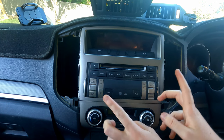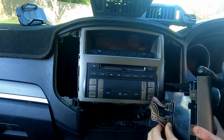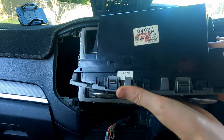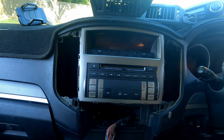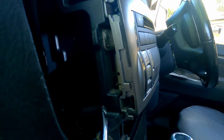Then you're going to want to remove your air-con unit. There are a few plugs in the back that you're going to have to wriggle out. There's a little tab on them — you can press it in to remove them. Now we've just got to remove this big boy. To take the actual stereo part out there are just a couple of clips behind here. It's a little bit tough so I'm going to put the flathead in and crank them to pop them, and do that on both sides.